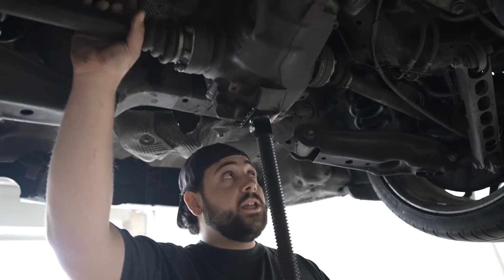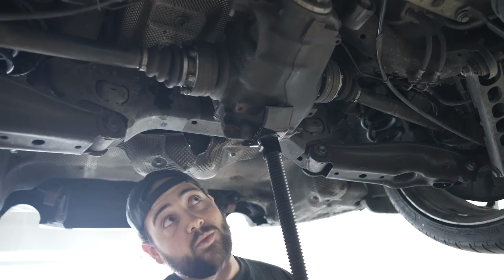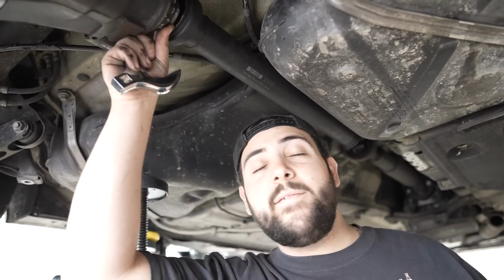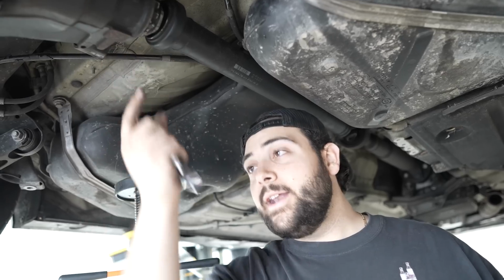Okay, first step is to remove both of these tiny little axles. It's just a bunch of E-Torx bolts. Once that's removed, we have to figure out how to remove it from the drive shaft. I think you need like a really big wrench. So to get this nut off, you need a special BMW 50 mil tool that's shaped for getting this diff nut off. Now, I don't have that.